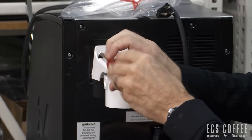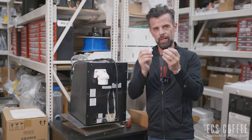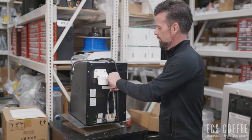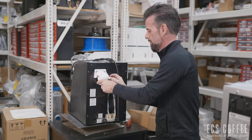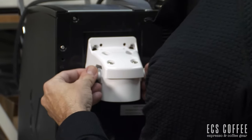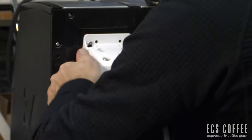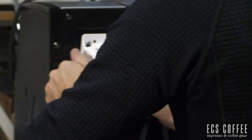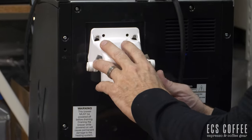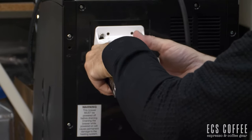One more thing — there are extra parts that come with the kit. We need to put these fittings on each side of the filter head. You can use plumber's tape — Teflon tape — get these in and tighten them up on each side using a wrench. Make sure you get them in straight because these are plastic — hand-tighten first, then a little more with the wrench. You can tighten as tight as you can without over-tightening, because you can snap plastic. You can do this before you put the bracket on if you prefer. Then you've also got these little quarter-inch elbow fittings — they're the same diameter as the tube — and they just go in there to make it easier to connect the water lines so they're not sticking straight out; they go down behind the machine.